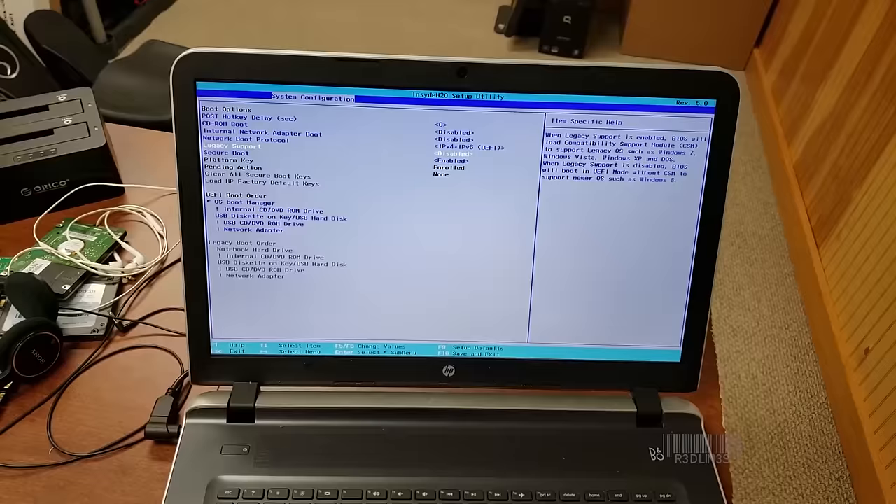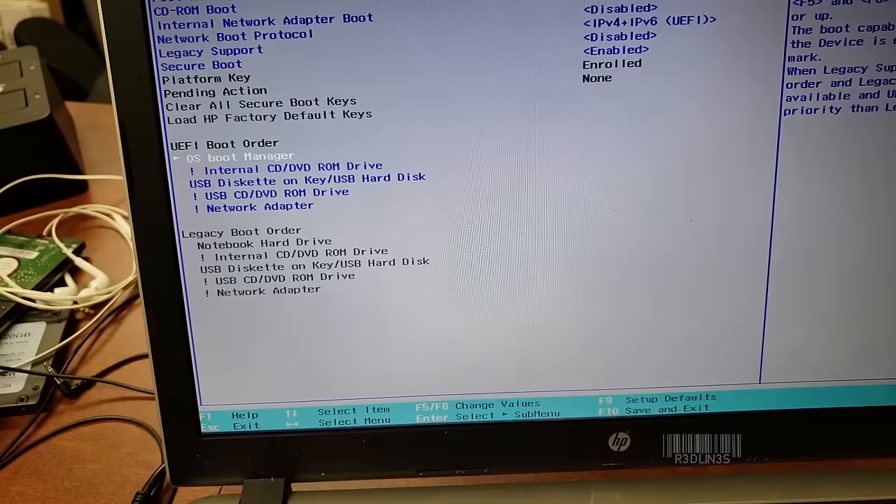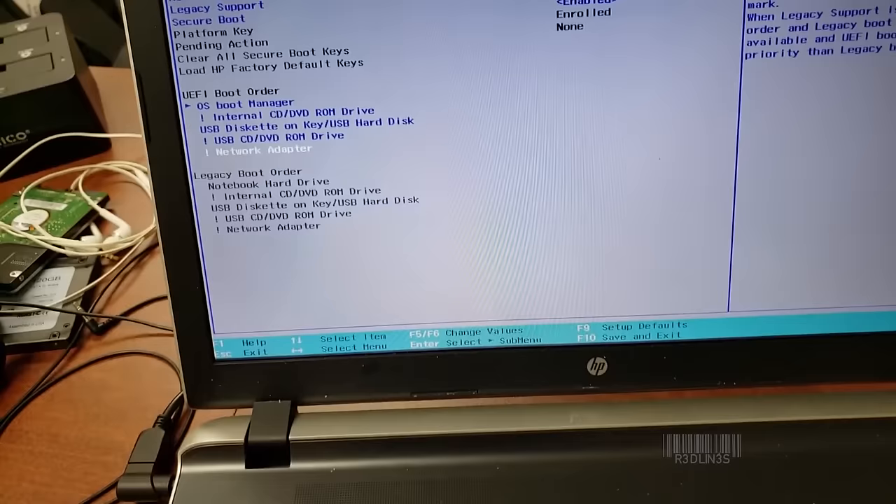The other issue could be that your boot order is wrong. In my boot order it shows OS boot manager — which is UEFI — first. But if you have USB listed first and there's a USB stick or a CD in the drive that you didn't realize, it'll try to boot off that and give you the same problem. We did it. Thank you for watching. If you can't get into your system's BIOS, they're all different — make sure you Google it. See you guys next time. Ciao.